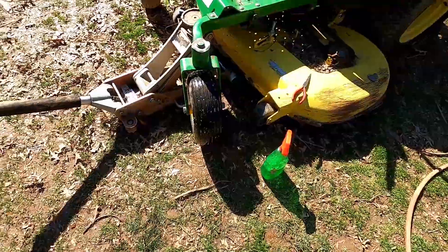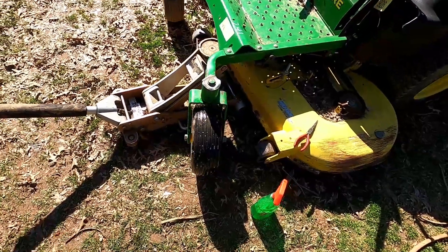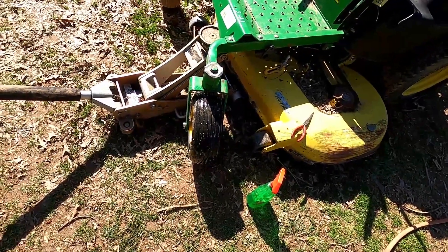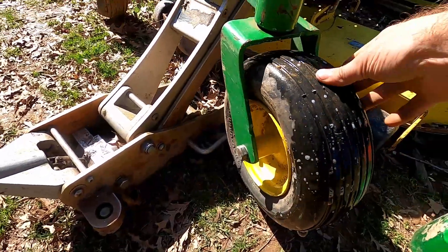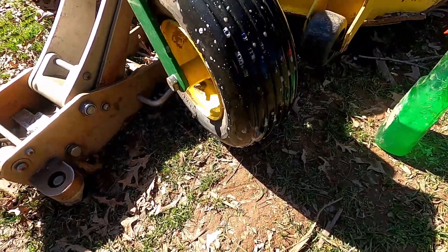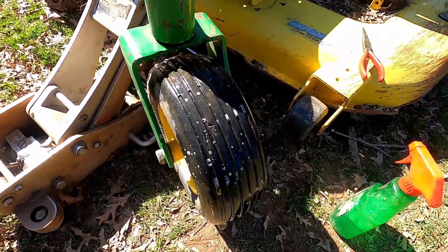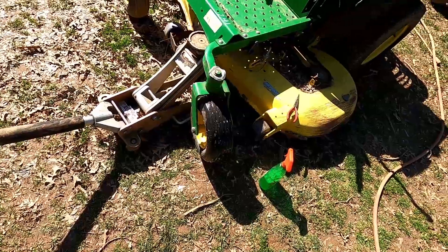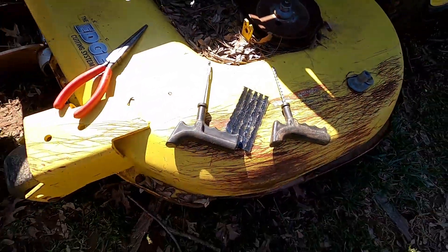You can get all kinds of stuff in there — nails, screws, pieces of barbed wire — run over it and it'll put a hole in it. Even some thorns off bushes can just poke a nice little hole in it. These tires aren't the thickest — this is a four-ply — but if you do run over something it will put a hole in it. I'm going to go grab a plug and stick that in. If you go to the store and get a plug kit...